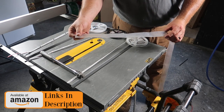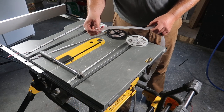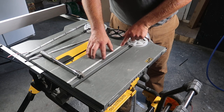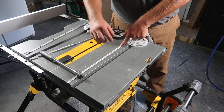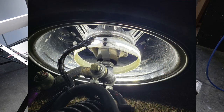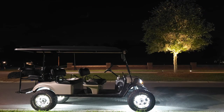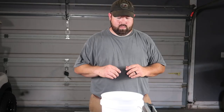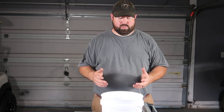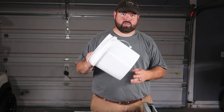This is clear heat shrink — you heat it over two soldered wires to protect them. On my limo cart, I put a non-weatherproof LED onto the ring itself, then placed this clear heat shrink over the LED and the ring. I cut the ring in half and heated it for a formed fit. I've had it on over a year and it's still working fine. You can make the rings out of all different kinds of materials — PVC, aluminum bar stock, or in this case, a bucket.